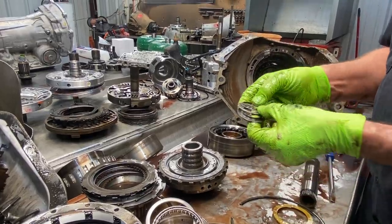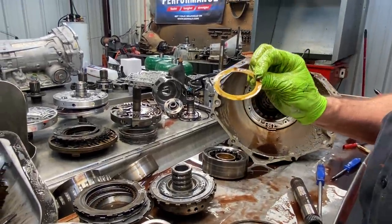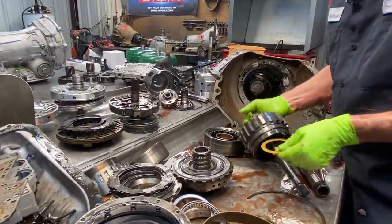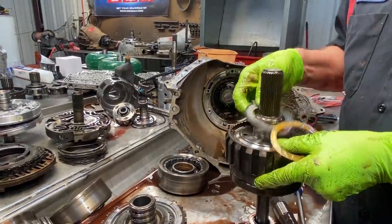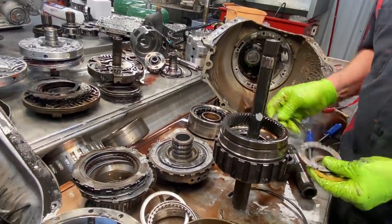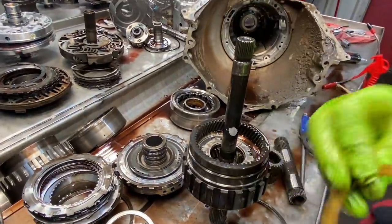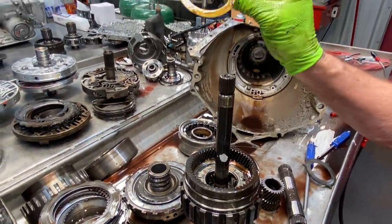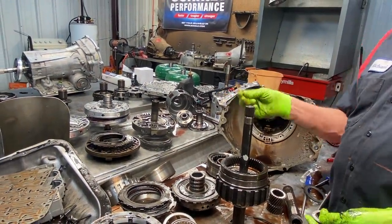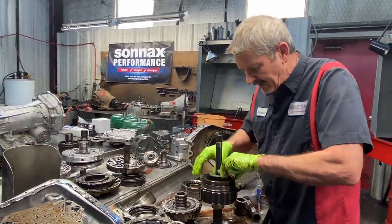This snap ring has a bevel on one side and flat on the other — you'll want to put it in with the bevel out. We have a bearing here and a thrust washer, 4-tab. We'll go back with a metal tab — you can put this metal 4-tab washer in here in the same place this plastic one did, and get that plastic out of there. Especially in a drag race application or for a farmer who's going to lug around in the fields and get this thing blistering hot — we're going to get all the plastic out of this thing that we can.